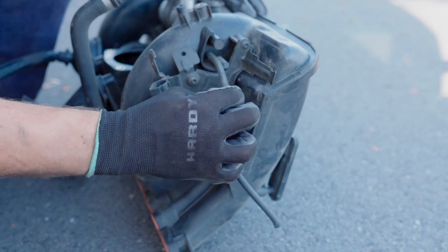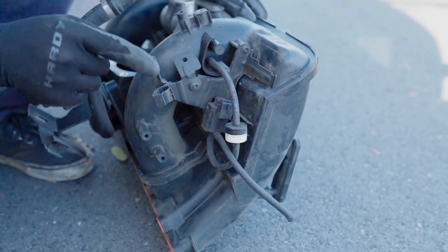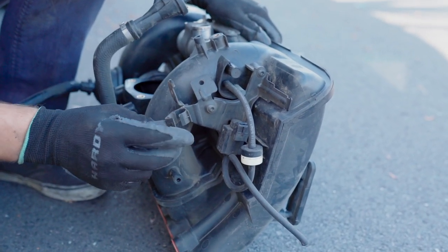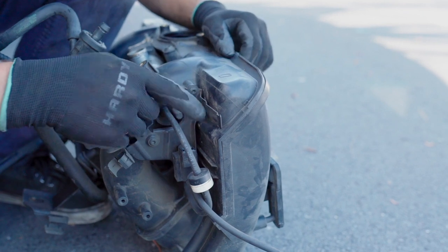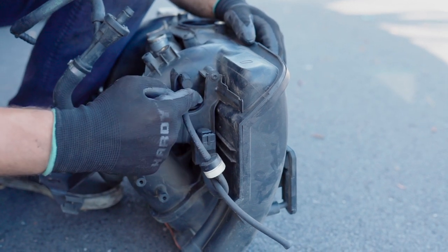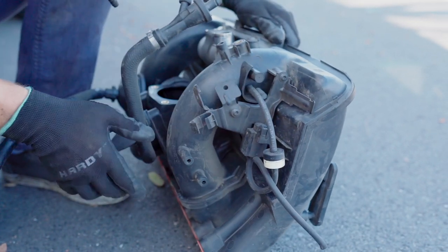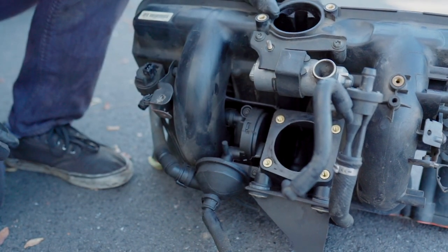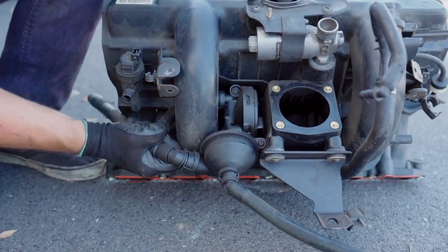Then, as you can see, those are holding up pretty good because I replaced those approximately 100,000 miles ago. This is the bracket for the fuel line, basically. It locks in place. And right here, we actually can increase the vacuum pressure of the crankcase vent valve if we connect the vacuum line from this port, because you can remove it, I'll show you later, to the crankcase ventilation port right here. That is possible. But now we'll focus on, as you can see, it's been approximately 100,000 since replacement of these